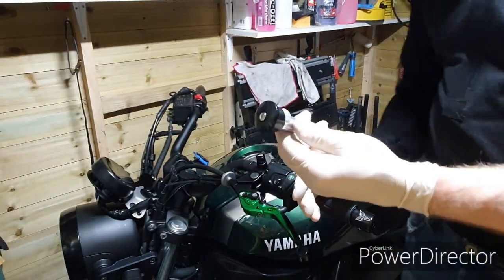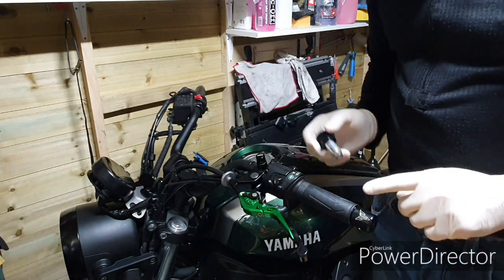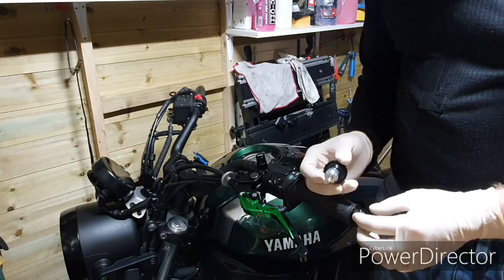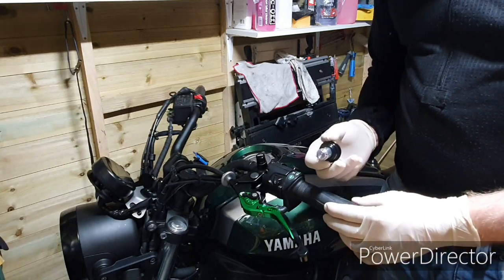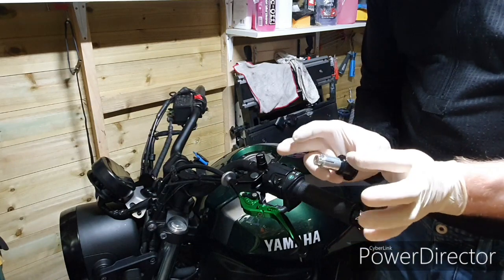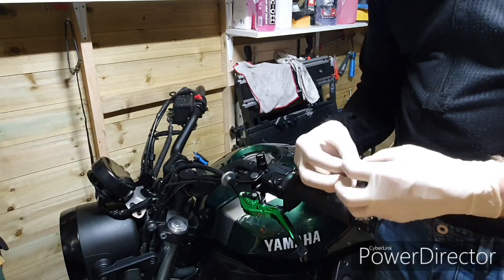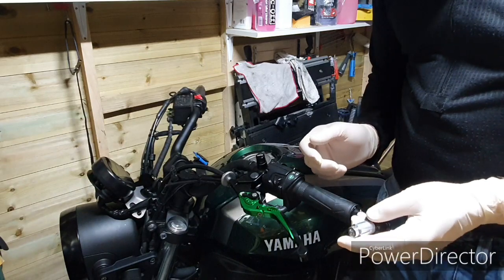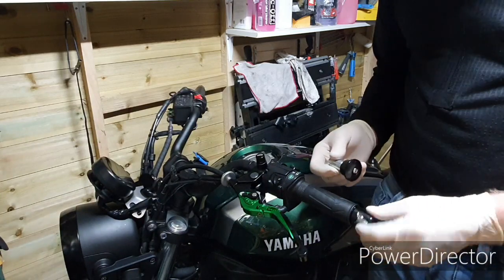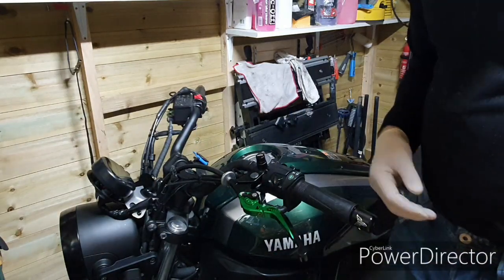The mirror comes with a weight going on the end of the bars. Yamaha has a bolt inside so you can't really put a standard one because there's no way to just screw or tie it out. When this expands — if you drill it — maybe it will work, or if you have a rubber that expands when you tighten it. With the bolt inside you just put it in, screw it, then adjust the ends like a bar-end weight. So I have to come up with something different.